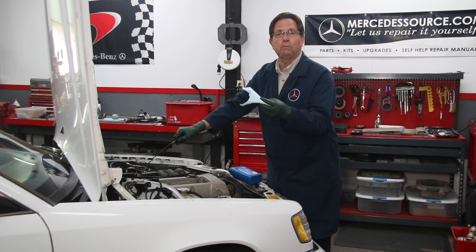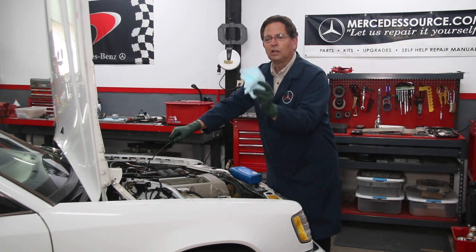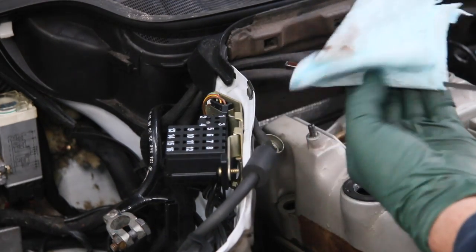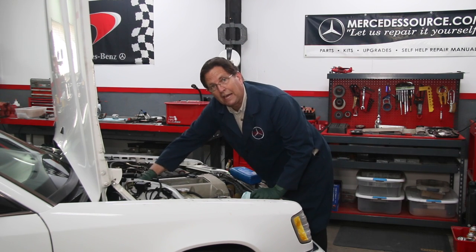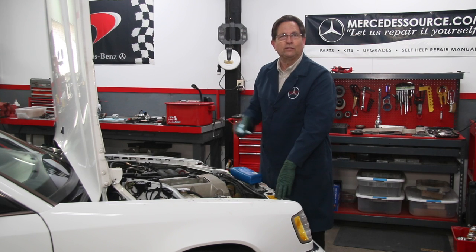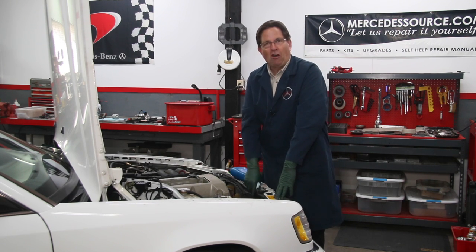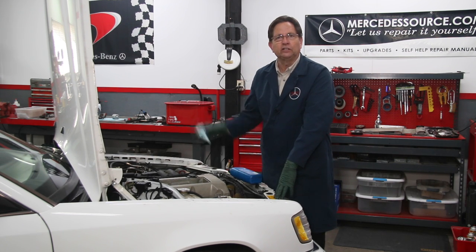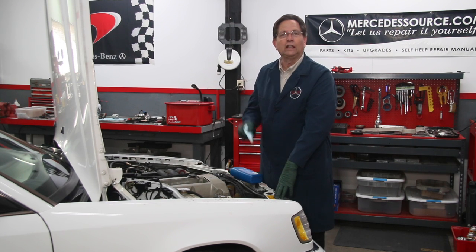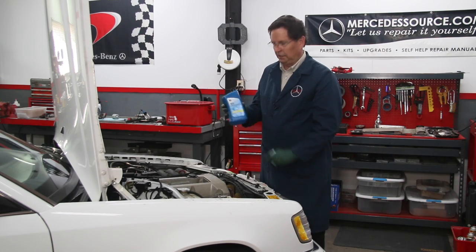This is really important: be careful about the type of towel you use to wipe the dipstick. Do not use white paper towels or shop towels that have a lot of lint. This is a special lint-free fiber cloth from DuPont. When I wipe down my transmission dipstick, I'm making sure I'm not introducing any particles or lint back into the transmission. I'm convinced lint has caused a lot of transmission failures over the years — I think it's part of the reason why many manufacturers in the late 90s and 2000s stopped allowing owners to check the fluid themselves. So just those two tips: use a totally lint-free cloth when wiping your transmission dipstick, and for a Dexron 3 replacement, Chevron ATF MD-3 is what I recommend.